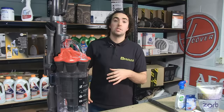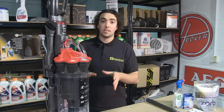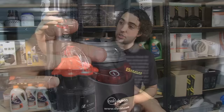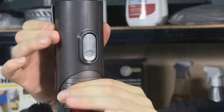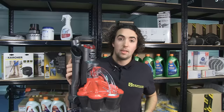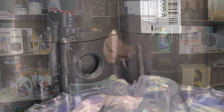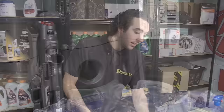The next places we're going to look at are the hose and the attachments. Now as these are the first parts of your vacuum cleaner to come into contact with dirt, they're a very likely place for smells to build up. Most bagless vacuum cleaners are designed to have the hose removed, either for cleaning or replacement, and in this Dyson this is achieved by pressing this catch on the top, which pulls the hose away from the body of the vacuum cleaner, and turning it round and pressing this button on the back to remove the wand from the hose. Then we can remove the canister in the usual way, before finally pressing this little button behind to remove the hose from the body altogether.